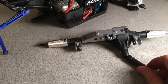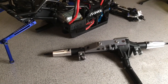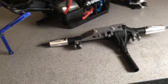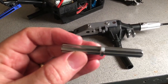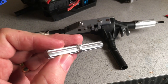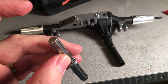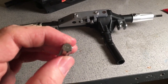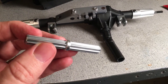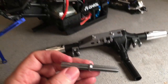Also, I installed the plastic Wild Boar drive shafts, and on the Rock Racer I used the MIP drive shaft. I thought I would try this plastic setup because I noticed that STRC makes an aluminum spline to go in there. I know that people take the stock spline and put a steel rod into it to make sure that it doesn't compress and twist, but the way I see it, this may actually make this drive shaft hold up, especially since we're turning smaller tires this time around.